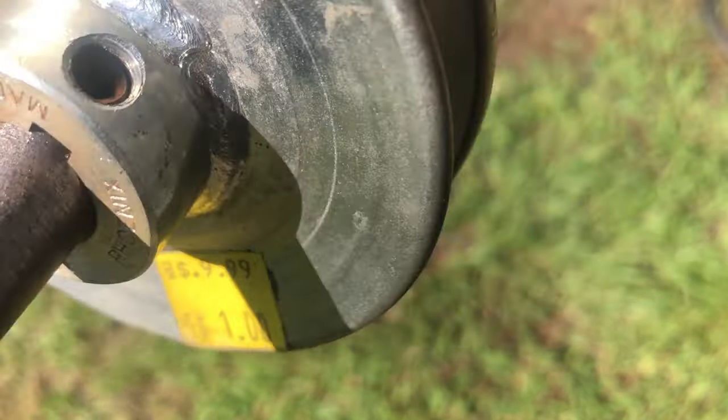So I've got my drive shaft sitting in place. It is level here. If we check it on the frame, it is level there. That's about where it needs to go, but I don't want that to interfere with my motor mount. What if we were to flip it over and mount it to the bottom of the motor mount? Something to think about.